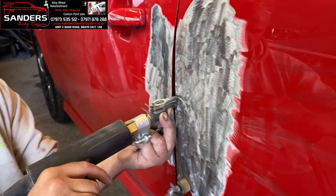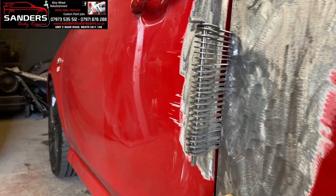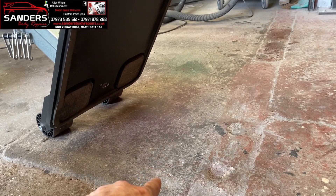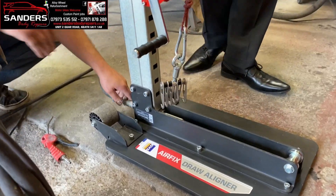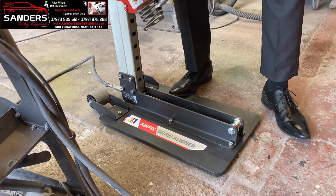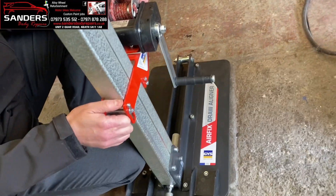Don't forget these tabs are reusable. You can see just by using the sucker we've pulled out a load of dents already. If you look underneath here, you can see the sealer goes on the edge and this will actually suck onto the floor so it can't move. We'll do a demonstration right now - I'm literally pulling on this and it won't shift, it won't budge at all.